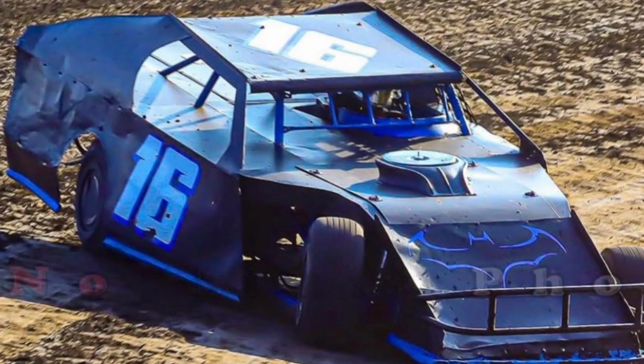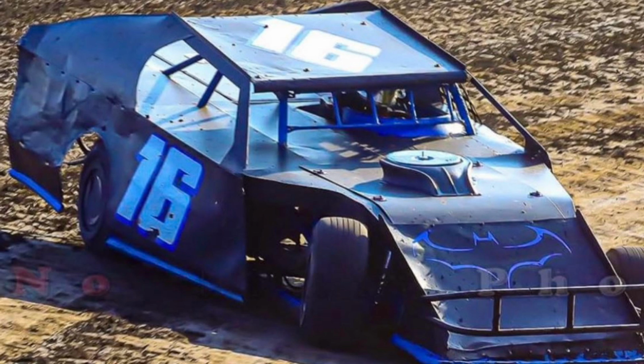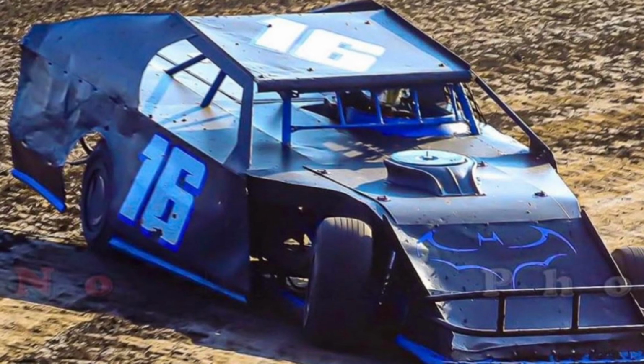Gary Dunsworth at Dunsworth Machine, he had a circle track engine that was on the dyno. These are what they call their B mods. Anyway, they are pretty tightly regulated engines. They're a 350 engine. If they're lucky, they're going to make 400 horsepower. Usually they make 370-ish, because usually they're running on a 2-barrel. So they run a Performer EPS manifold. They've got cast iron heads. They've got a flat tappet camshaft. It is not fancy at all.